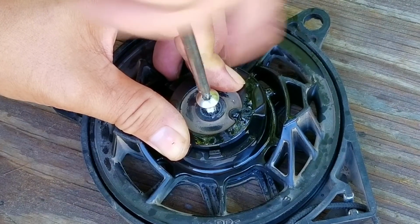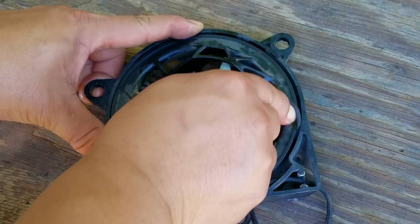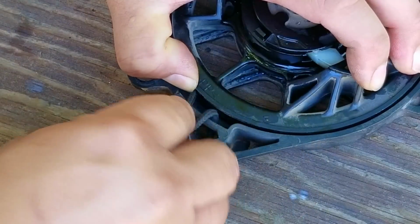Once that's done, we can then wind the spring using the rope. I'm only going to put a few turns on it and then see if it's enough to wind all of the rope onto the pulley. If not, I'll then add a couple more turns to it. Try to resist the urge to put too many turns on it, otherwise the spring might bind up.